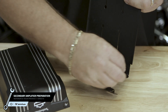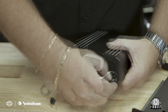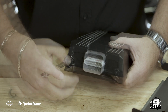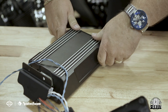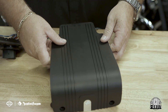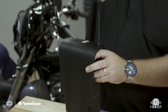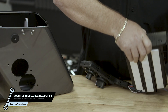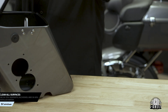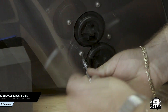Move to the amplifier and mounting bracket. Start by attaching the two provided rubber grommets to the bracket and attach the two stud pins to the amplifier on the harness plug side. Now let's make your wiring connection. Slide the stud pins on the amplifier into the rubber grommets on the bracket and lock the amplifier in place. After that's done, attach the amplifier cover, securing it with the two provided bolts, and then clip on your wiring harness cover. Before you mount your amplifier and bulkhead, we recommend test fitting in the saddlebag. Make sure your amp is in proper placement and the bulkhead lines up with the mounting holes. When you're ready, secure the bulkhead with the six provided bolts using a T15 wrench. Now remove the backing tape and firmly press the bracket to the saddlebag.